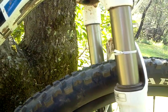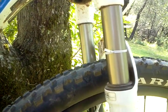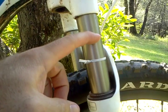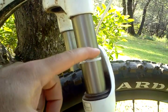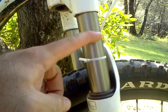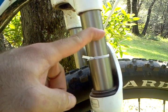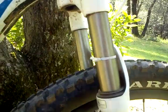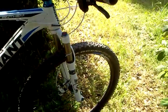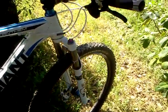Take the shock pump with you and go out and ride the trail and see how you're doing. If you're not using a whole bunch of your travel, take a little air out. When you get your travel meter kind of up in this area after a good trail — here's too low, here's too high — right about there. If you're in that realm on your fork, with about three quarters of it used after a serious trail, then you've got your suspension adjusted pretty good. You'll notice the responsiveness and the comfort in the bike. You pay for all the suspension, you might as well use it.